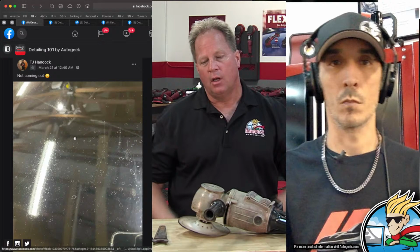What are you using for a polisher? What's your tool of choice? Look, there's a number of things you can do. One, you can get more aggressive with your abrasive technology. You can get more aggressive with your pad. You can get more aggressive with your tool, and you can get more aggressive with your technique: more passes, more pressure. But to me, that looks like something a quality compound should be able to address.